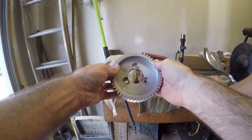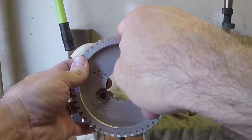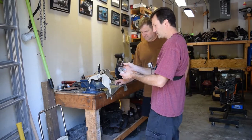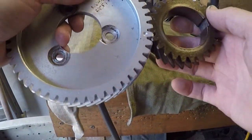If you remember, in the crank disassembly I showed you the two dots. They line up with this dot right here. This is the crank gear. You got the two dots I showed previously — that's where they mesh together. That way you know your cam and your crank are clocked or timed together.